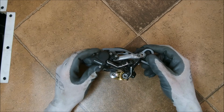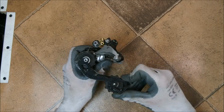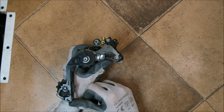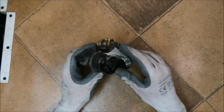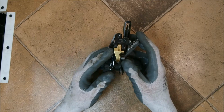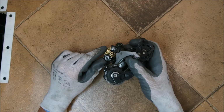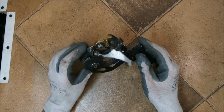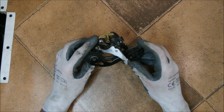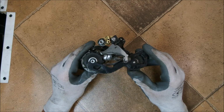However, these derailleurs come with a multitude of disadvantages. First of all, as you shift, you are always tensioning some spring. So, trying to shift to certain gears requires quite a bit of force. Moreover, you are pretty much married to the size of the cassette the derailleur was designed around. This Saint, using a little mode converter gizmo, can handle anything from 28 to 36. However, regular Shadow derailleurs from Shimano, trying to run them on anything but 36, 34 or 32 is an exercise in frustration. Saint will handle 28, but nothing less than that.